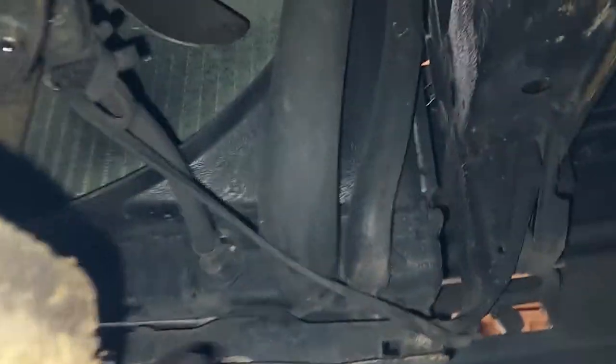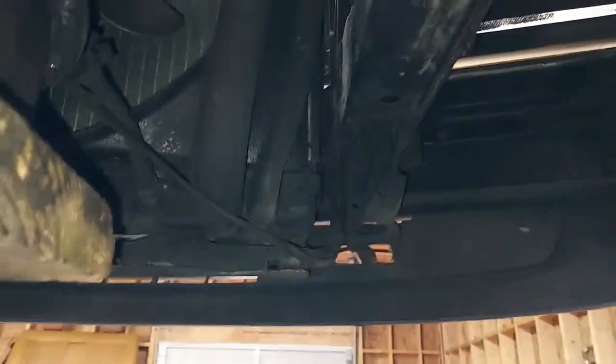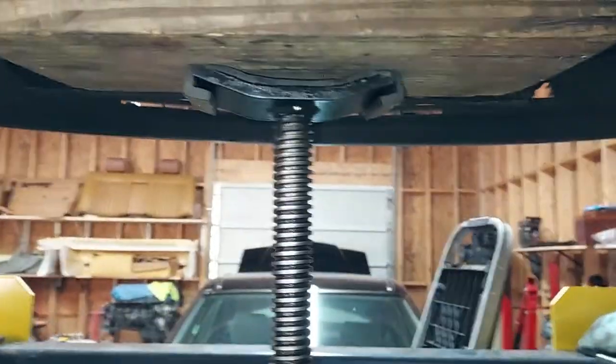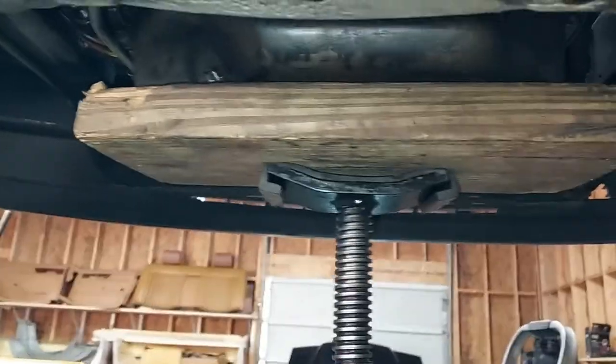And the limiting factor when you're lifting up the engine, if you've undone the shroud and you've undone the throttle linkage up top, is your lower radiator hose. So you just basically want to go as high as you can with that. And it's going to put a little tension on it. But that's our, see, we still have some room to go. It's not under an incredible amount of pressure. All right, we'll try it and see how that is right there.